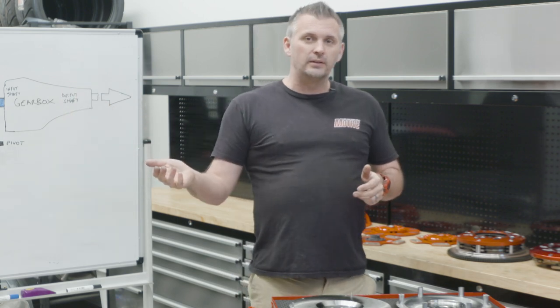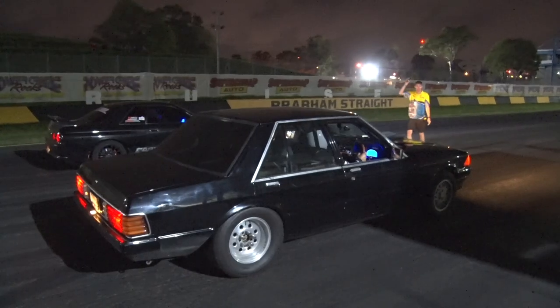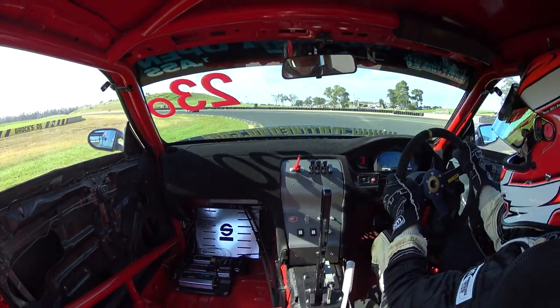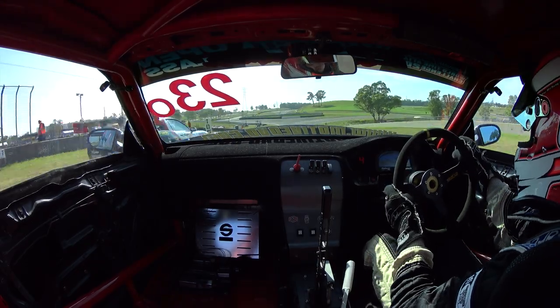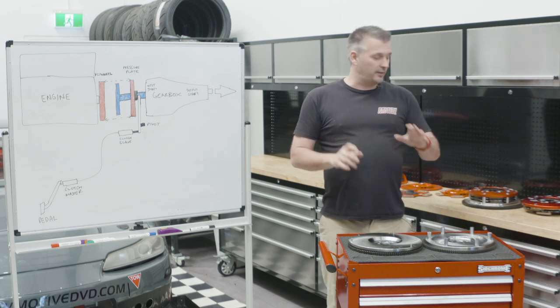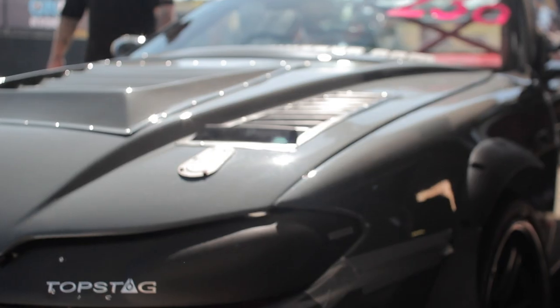But then you have to counteract that with the fact that once you're moving, you've got more inertia to try and move — so therefore, not as responsive. But with drag racing, your RPM and engine speed is always going up anyway, so it's not as big of an issue as a time attack car where your revs are going up and down all the time as you go around different corners. When it comes to your flywheel, you don't want to go out and lighten it as much as you possibly can. The flywheel and clutch assembly in our GTR isn't really lightened all that much, but the one in our Silvia — our time attack car — is as light as possible.